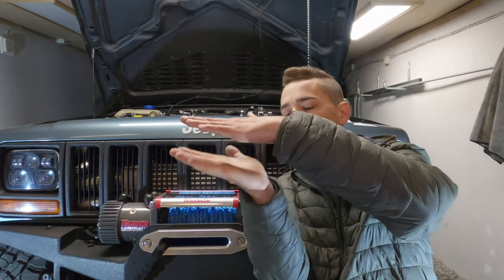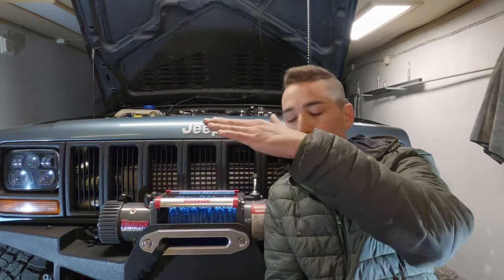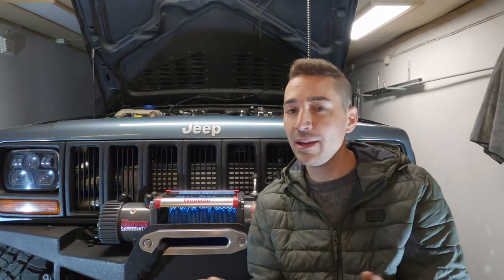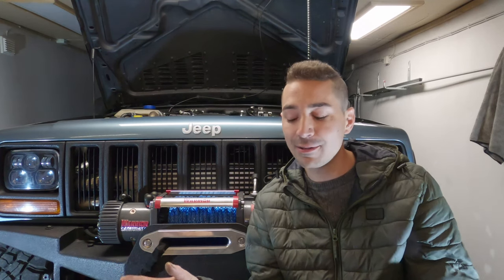The explosion's happening, and it's recoiling away very quickly, and then cool air is being fired in by the turbo, lots of charge air, which in my case is quite a bit, and that's obviously a good thing too. So that's cooling it down as well. You also have to remember, aluminium disperses heat very quickly into the oil, into the cylinder, into the surrounding structure and material around it.